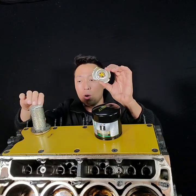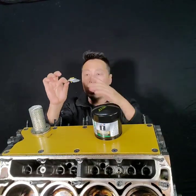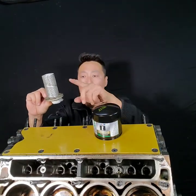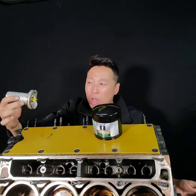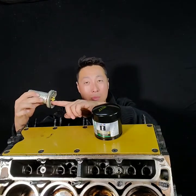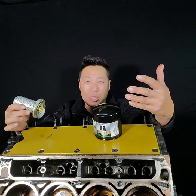...this valve right here will open up. The valve pops up and it allows all the oil that's supposed to get filtered through the media material to come around and just go right back into your motor unfiltered. For a lot of us who drift or race and do a lot of high RPM stuff, I can foresee this valve being open maybe the majority of the time just due to the high oil pressure we're seeing in our vehicles.